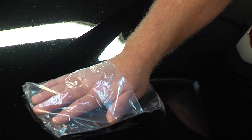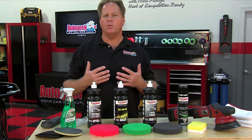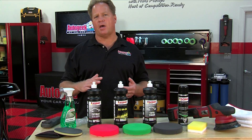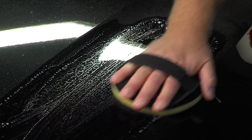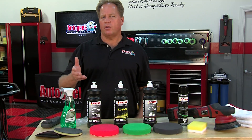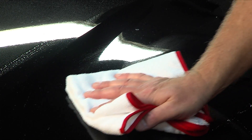The first thing you want to do is feel and inspect the paint. If you detect any above-surface contaminants — which will usually feel like bumps — go ahead and use the Sonax clay disc to remove them. Using the clay disc is really easy: it comes with its own hand backing pad that attaches using Velcro. Take the Sonax glass cleaner, spray it onto the panel, and be sure to lay down plenty of product for good lubrication. Then take the clay disc and rub it in a back-and-forth line over the paint, usually in the direction of the length of the panel. As you rub, you can feel the contaminants peel away; when the clay disc starts gliding smoothly without binding, the contaminants have been removed — stop, wipe off the panel, and move to a new area.